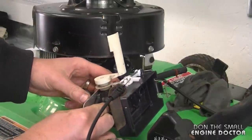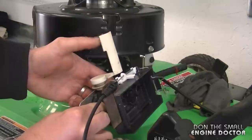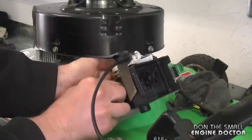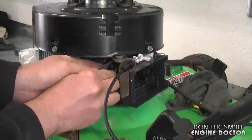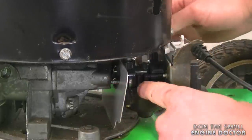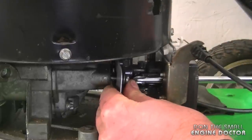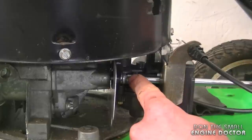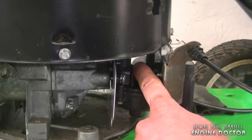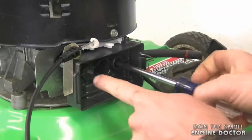Hold the screws and the metal plate on the carburetor firmly with both hands. Now you want to insert this plastic flap underneath the cowl — just tilt the carburetor, you're going to see a hole under there, and bring it up like this. Line up this screw to the hole and do the same thing on the other side. Have your screwdriver ready, reach down inside, and don't tighten it up yet — just leave it snug because you need to put in the other screw so the carb goes on evenly. Once both screws are in, tighten them up.